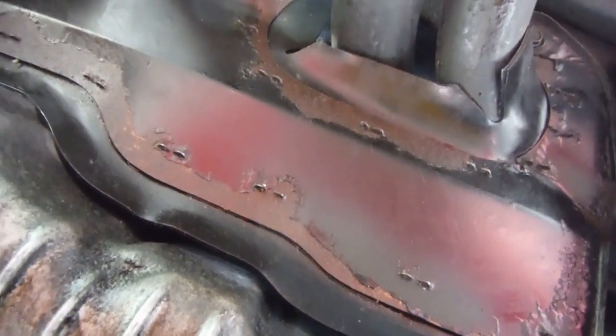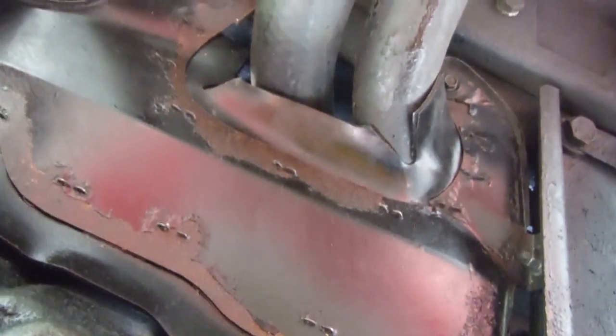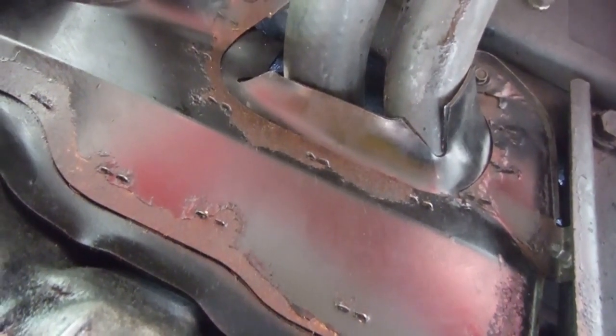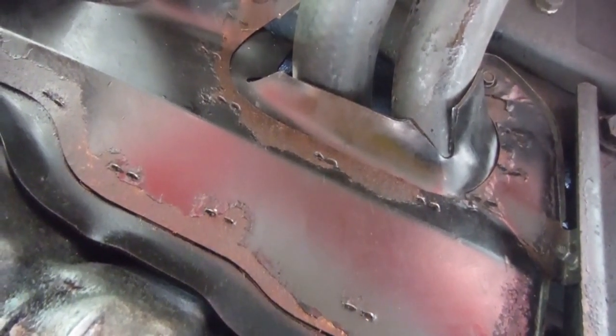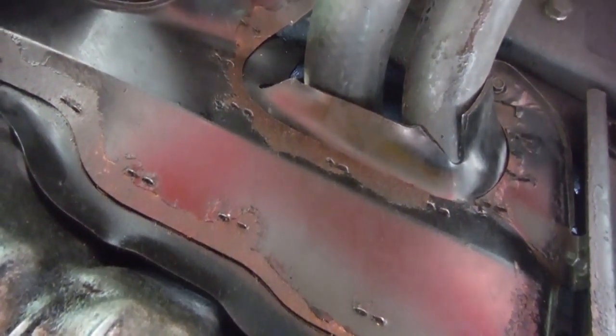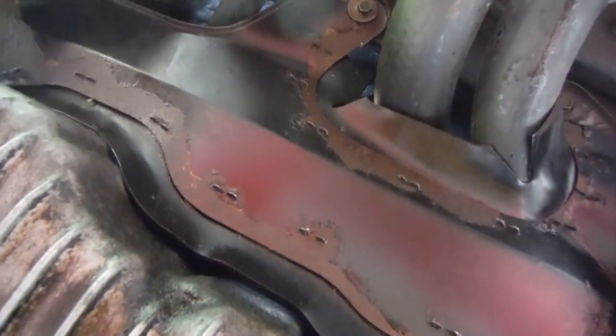Now you'll see the baffle plate on, and that's an important part of the car. It directs air to the sump, which, as I've said before, is an oil cooler really, and people leave them off Volkswagens and air-cooled Volkswagens, and like I say, it's an important part. Air-cooled engines on aircraft, the big Pratt & Whitneys, had a complex system of baffles, otherwise the engine wouldn't get air going to the right places to keep it cool. So make sure that's on yours and that it's okay.